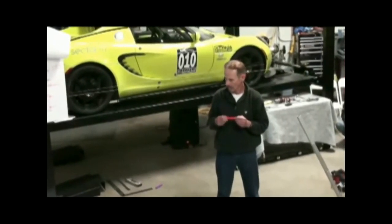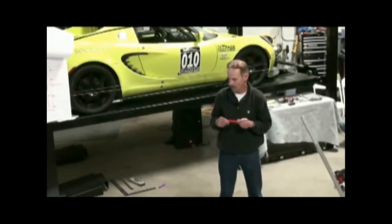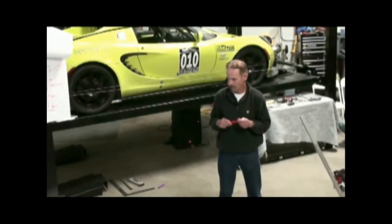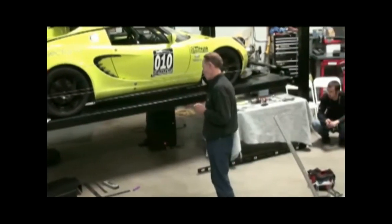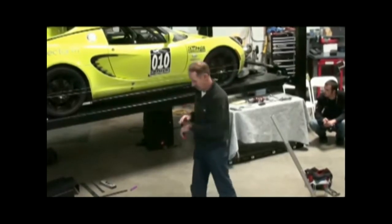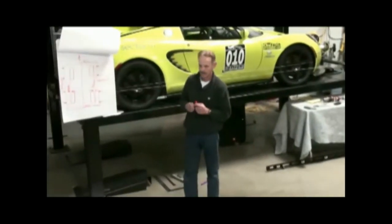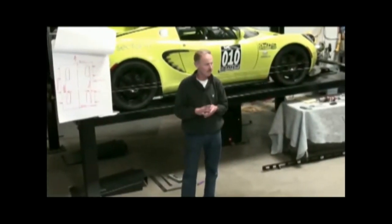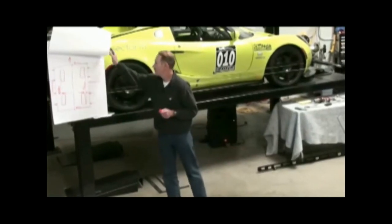The use of aluminum bars is a really big time saver. I'm actually going to build the grid like Andy has built here, because the nice thing is if you're an eighth of an inch off on one side, you only have to move a sixteenth of an inch to achieve symmetry on both sides. And instead of moving two sides, you're moving one side.